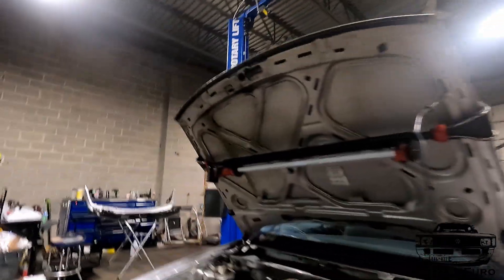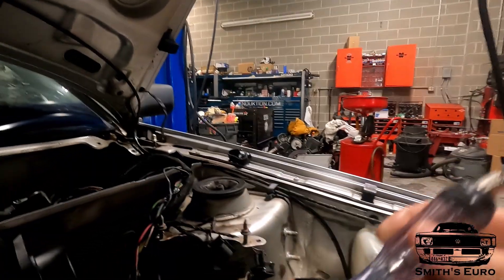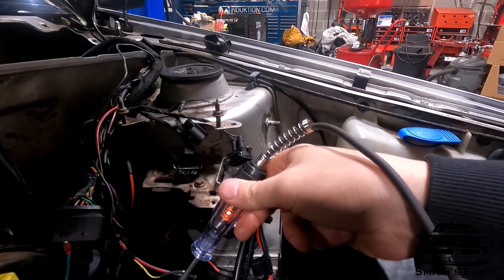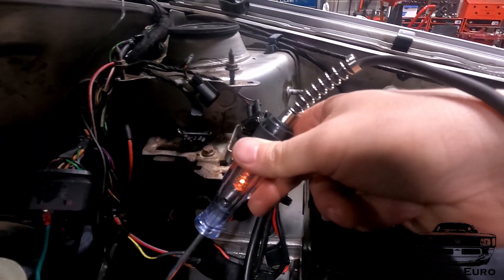You come out here, you can hear the ECU is going, you can hear the throttle body making its nice zip-zap noise. But you take the test light - obviously it's connected to ground. Now this is a direct ground and I have it ran underneath the battery box. It's just not a good connection. How is it not a good connection? Because I know it's a direct connection. So I should have basically no power coming to this test light, but if you see I put this on here and you see that weird pulsing power - that basically means the power is not coming through it. It's stopping here, stopping on the ground wire. That's a telltale sign of a bad ground.